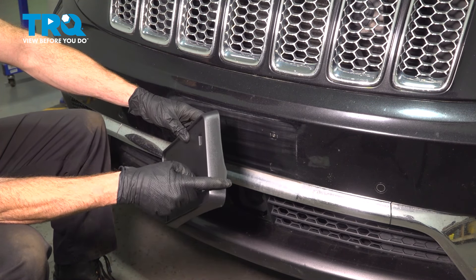Align it with its mounting holes. Start in your two mounting bolts and snug them up. Keep in mind, you're only screwing into plastic. Once they bottom out, just take them a tiny bit further than that, but you definitely don't want to over-tighten them and strip anything out.